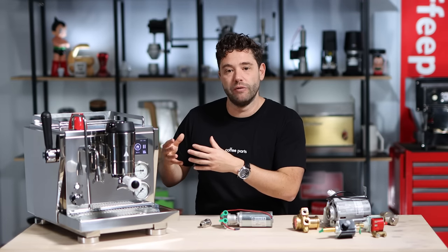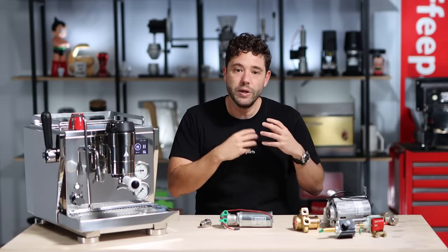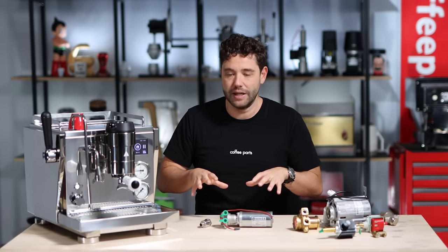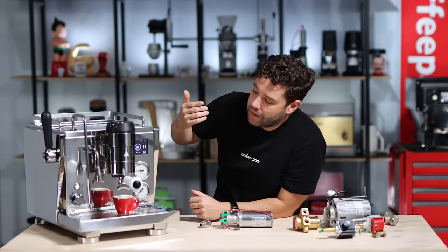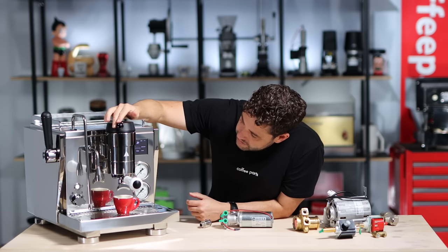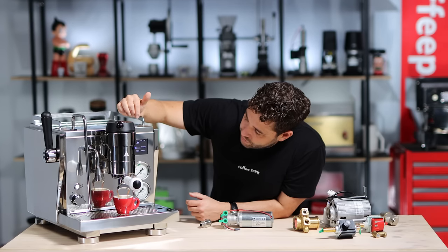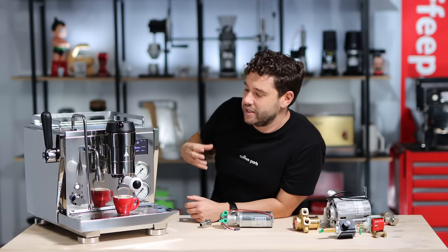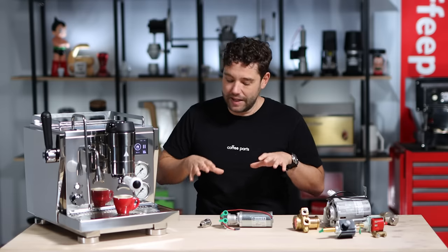If we jump into this machine and do a coffee, we can see that by moving this dial, we ramp up and down the speed of the pump — something you can't naturally do on the vibrating or rotary pump, with the exception of the Slayer 1 Group using a needle valve. We've got coffee loaded in. Starting off at two and a half bars, now ramping up to eight bars in this pressure profile. Now pulling back down to five bars and finishing off at two and a half bars. Notice how quiet this pump is and how much control it had throughout. That's just one profile set in the machine — you could be moving it from any bar level to any other, every second, and really draw out what that espresso looks like to you. That's what a geared pump can do.